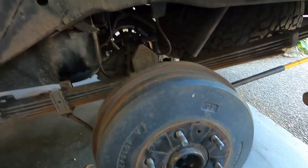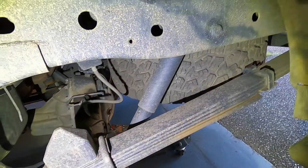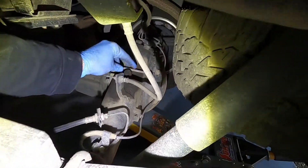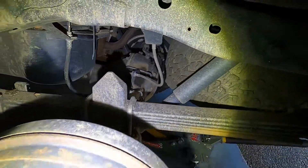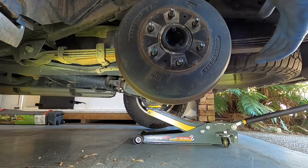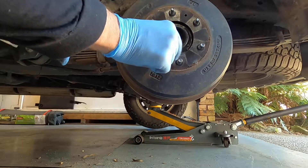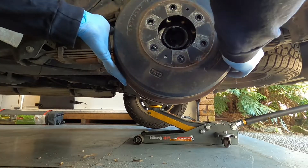Now we've got the rear wheel off we'll check the rear brakes and have a general look underneath the back. Check the shocks - make sure they're not all wet with oil residue. Check the back brake line - the only rubber line you have in the back between here and your diff. Check for any leaks around your diff area. This is your breather - make sure it moves freely back and forth, it shouldn't be all caked up with dirt because that's your diff breather. Now we'll pull the brake drum off. It might just come off - if not, there are two M10 bolt holes to use as pushers.